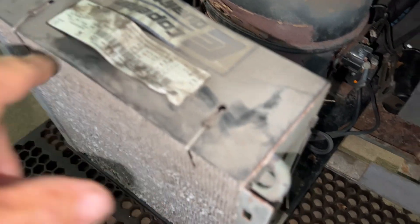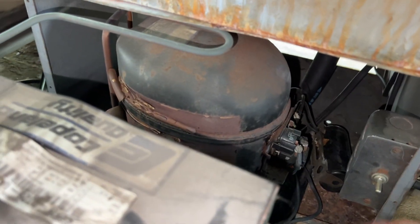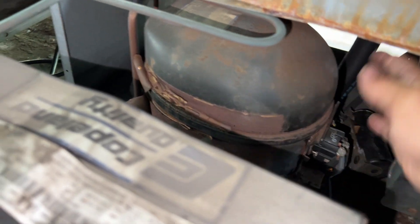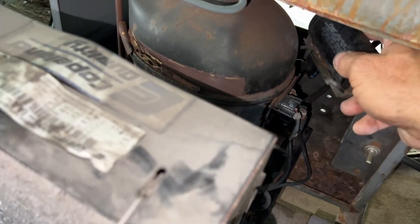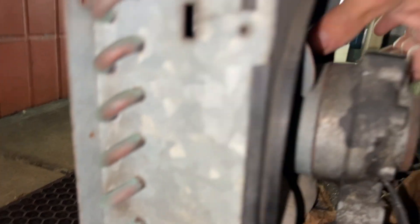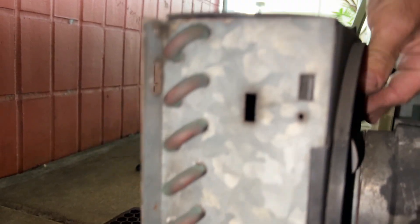It's a little coping. This is a 134A system and it's the super special no-cover-on-the-start-components edition. We have a capacitor hanging out back here — I wonder if it fell off and got kicked down the road. I can see the temperature control back in there. This motor is definitely seized up tight. I'm going to have to get a motor — I think I've got one on the truck. The compressor seemed to be working though; it was building heat.